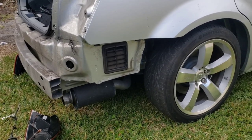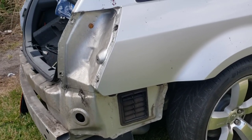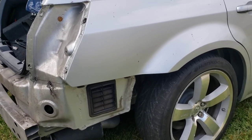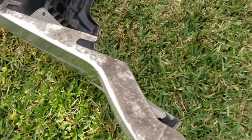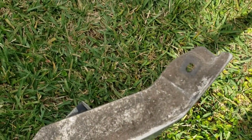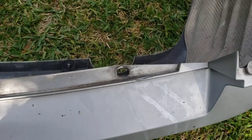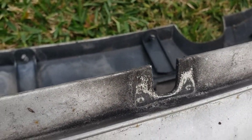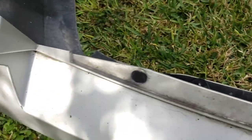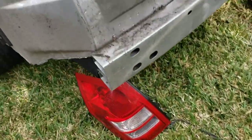I'm doing the back lights — let me show you how easy it is, show all my people who want to know how to do the back lights. When people tell you you can't do it, it ain't nothing. Take this bump off — you got a screw right there, you take the screw out. You see those right there — these slide into those when you put the bumper back, that's where that screw goes. You got some push pins right here — got one right there, this slides in. You got one right there, one right there, same on the other side. Slide the bump off.